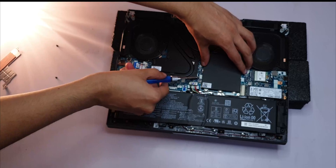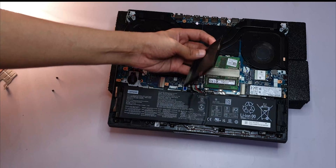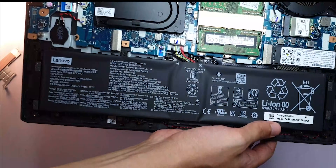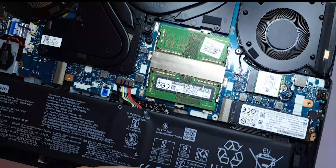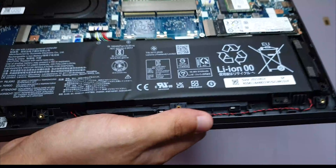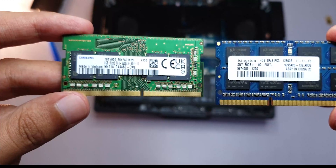Let's look at the RAM sticks. They're underneath a metallic cover that doesn't have any screws — I don't like that design, it's a little annoying to take off and put back. One screw would have been nice. There they are: the DDR4 dual-channel memory sticks. They are 16GB out of the box and expandable up to 64GB. I'm gonna upgrade them at some point, maybe up to 32GB. And if you haven't seen a DDR4 memory stick right next to a DDR3 one — the pins are a little bit different.